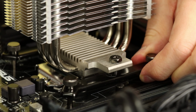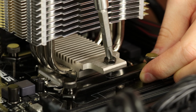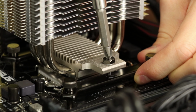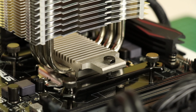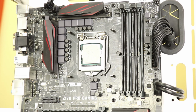This is where things go a little downhill in the not reading the instructions department. The screws in the base of the cooler don't meet up quite with the bracket below, so clearly something is amiss. I initially thought this was the way that the brackets were supposed to be mounted since the rounded edge of the brackets are on show, and that just seems to be the logical way to go. Have the best side on show, right? Well, I was still adamant that this was the way to go, so I decided to attach the brackets to the cooler first, and then mount the cooler with the brackets to the posts through the motherboard.